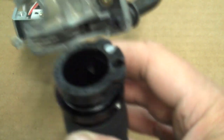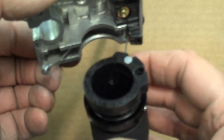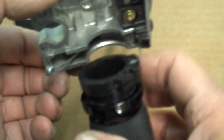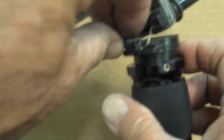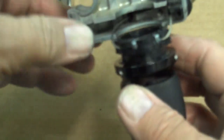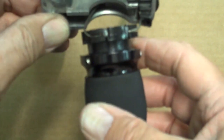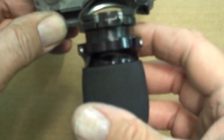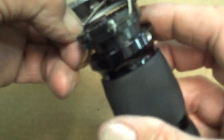Let's go ahead and put the new throttle sleeve into the housing — it's basically just a repeat of what we did before. Hook this cable in this way, just like that. Then as I rotate this around, hook the left side cable into that hole there. Do this while the throttle tube is not in the housing yet — you can't do it while it's in the housing. Then rotate this up into the housing, keeping the cable away from the edge so it follows the contour of the housing.